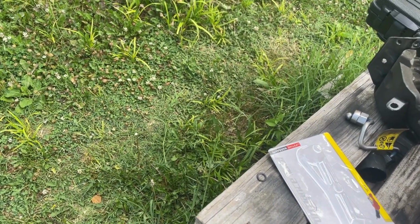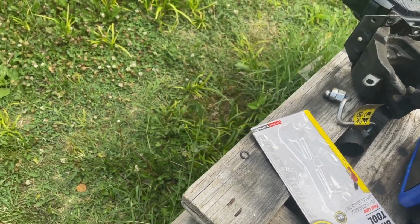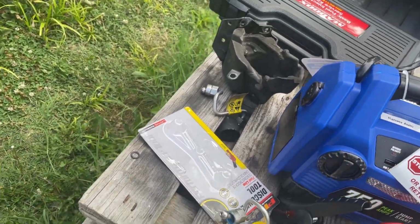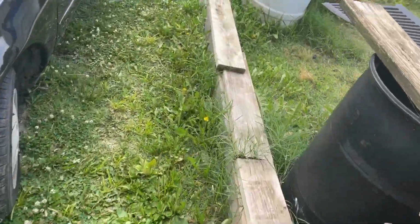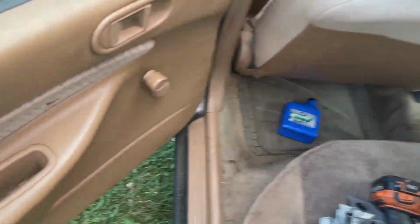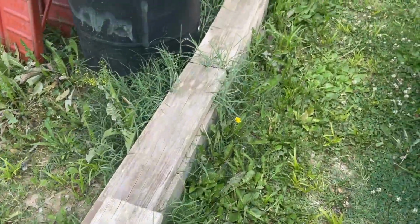Oh, yes, the Bosch O2 sensors. Don't use those on this car. They are not properly calibrated. The nose is wrong on it. Let me show you. On the O2 that you pull out of the back, it looks like a regular O2 sensor. Let me get the Denso one that we're putting in this car. Show you what I'm talking about here.